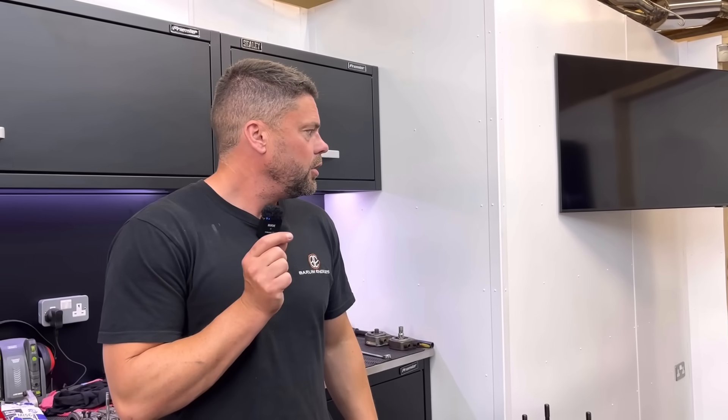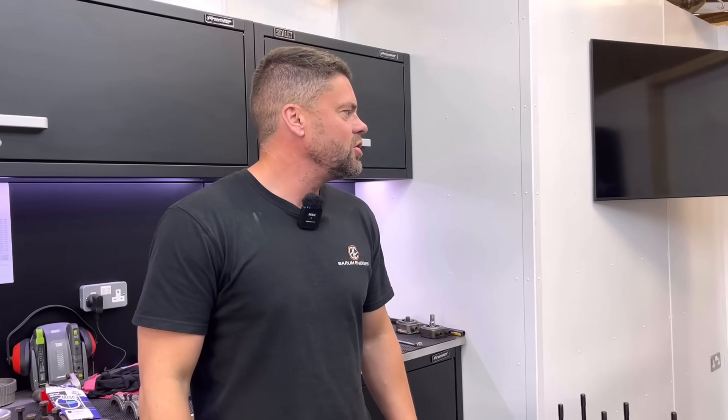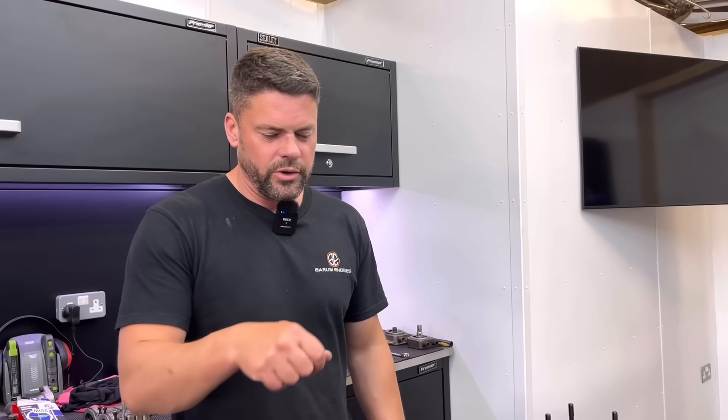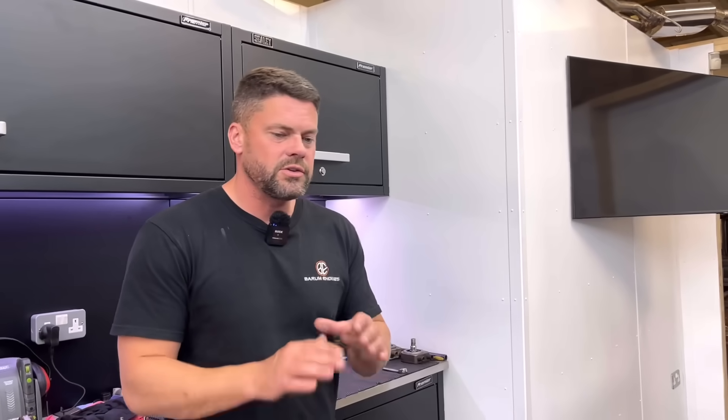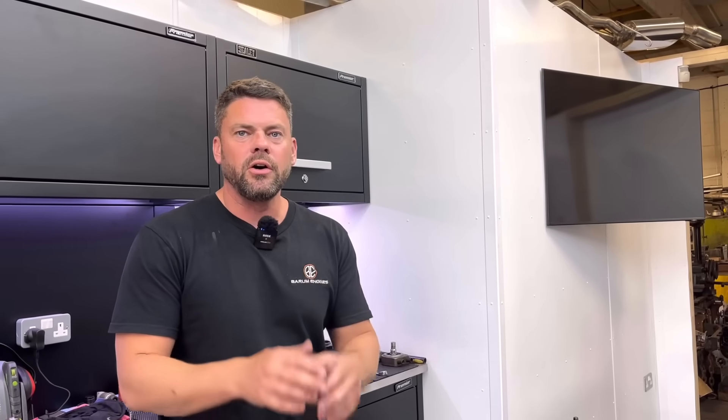John's checked and polished all the cranks, they're all good. The four blocks I've blasted, faced the tops — got very overheated these things. Bit bent. Two of them, I've took half a mill off. So I've just wrote on the top, the last lot were the same. They seem to get really warm and the bores are sort of open deck really at the top, and they just distort like buggery.